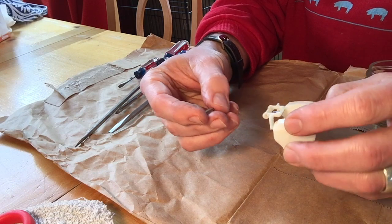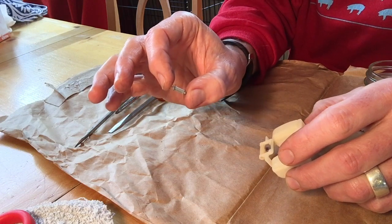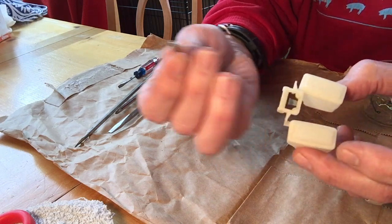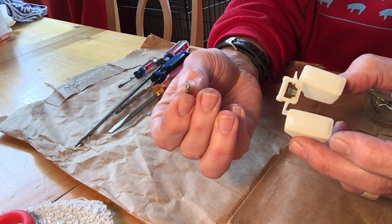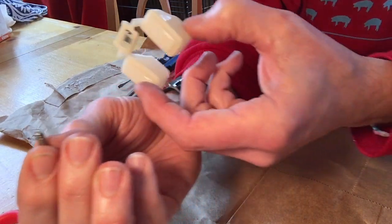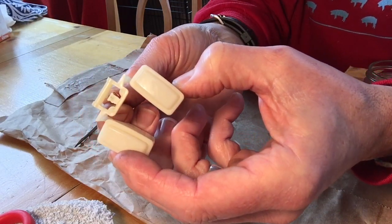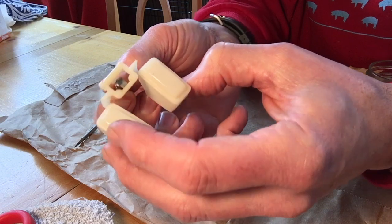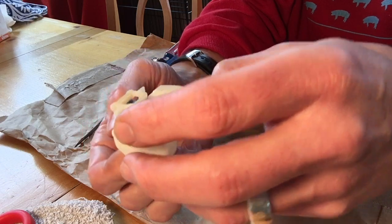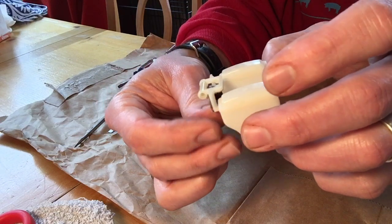One of the things that I actually couldn't find when I opened my carburetor, and maybe it just fell out, was the needle valve that connects to the float. So I want to make sure that folks know where that is and how that fits. You'll notice it's got a little hanger in the top. I'm hoping you can see the little wire hanger. It actually connects up underneath the back of the float here, and it will slide over this rectangular part so it hangs down. You can see how it hangs down there, and that's your counterweight for your float.